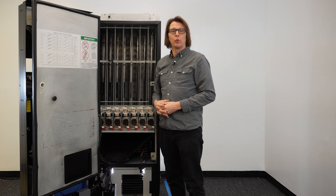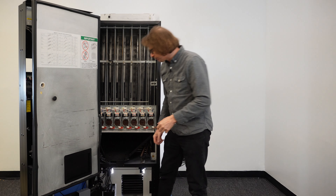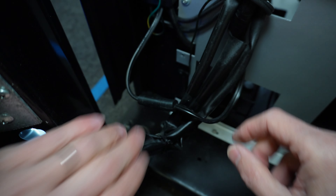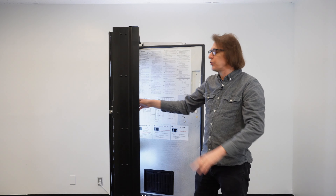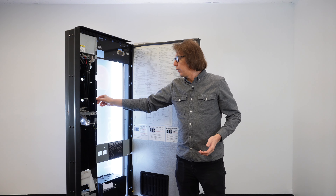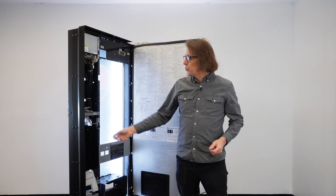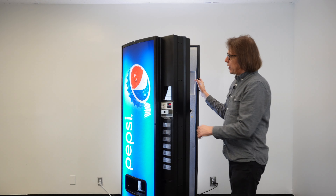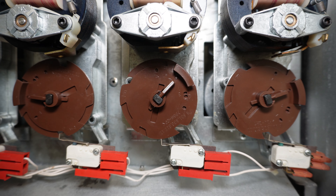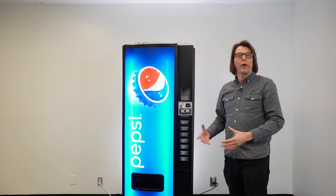Once the can has been removed and the jam is cleared, we need to get this motor back to its home position. That's where the homing process comes in — when you close the door or press the service mode button, you get that 'homing' message across the screen. Reapply power to the machine. There are three things you can do: close the door, press the blue service mode button to enter service mode, or pull the door interlock switch out to replicate closing the door. Pulling this button out lets the computer board think the door is closed, and the motor will turn back to its home position.